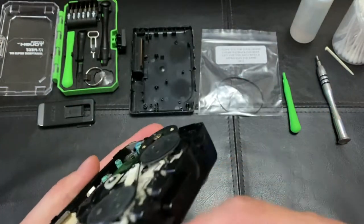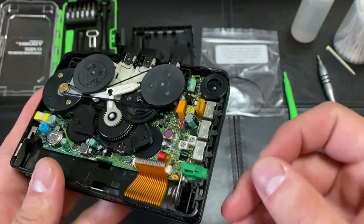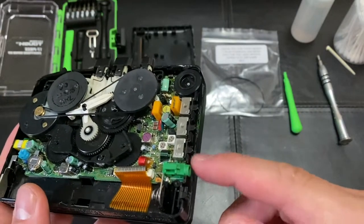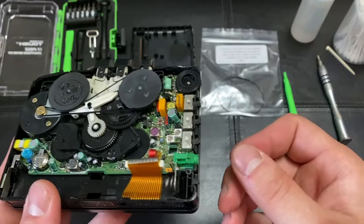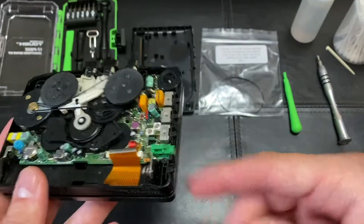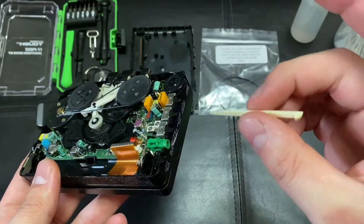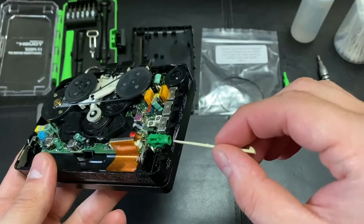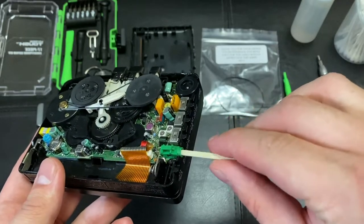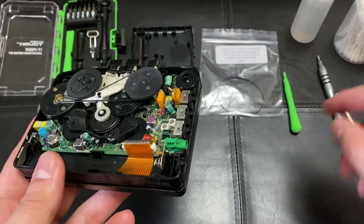A lot of times this is the only port, though some also have a line out. A lot of times when you put the headphones in you have to put them in three-quarters of the way and pull back to get both channels. There's usually some corrosion in there. A lot of times you can just take the actual 3.5mm jack and insert and remove it a bunch of times to clean it up. If not, a cotton swab won't fit, but something like a toothpick wrapped with a thin paper towel or lens cleaning cloth with a little alcohol can clean that up — then run the jack through a few more times to clear it.